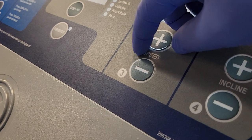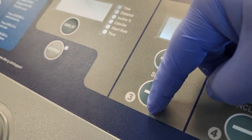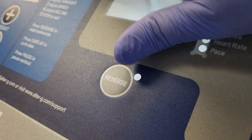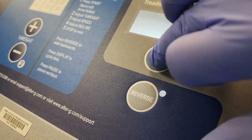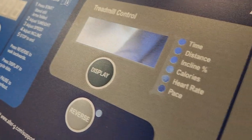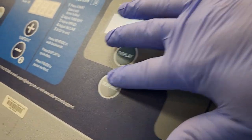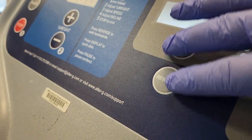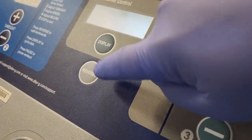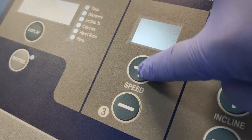Right here you can see the speed up and speed down — these are obviously the two most commonly used buttons. These are normally like a membrane, and on the back it's just open. You can see how I have it removed, so this part is rigid and this part is soft. Usually when you have these type of consoles, the buttons are pressed forward quite a bit, and if they're not pressed forward enough, you get this right here.